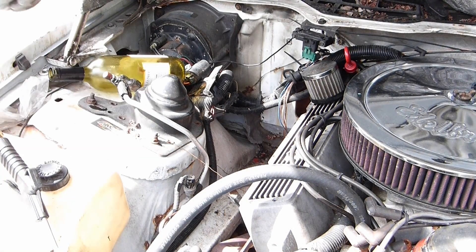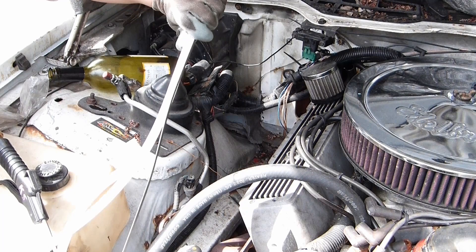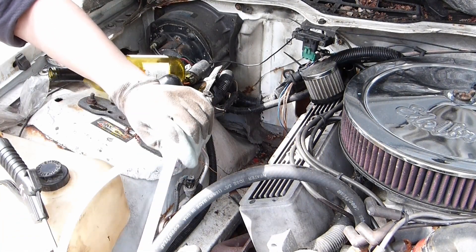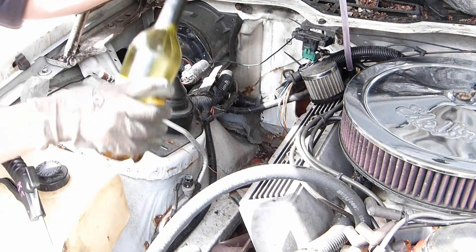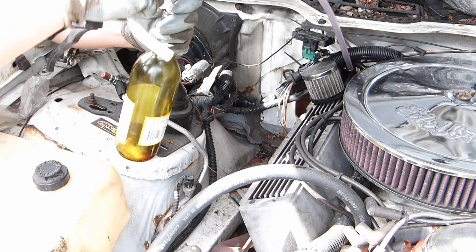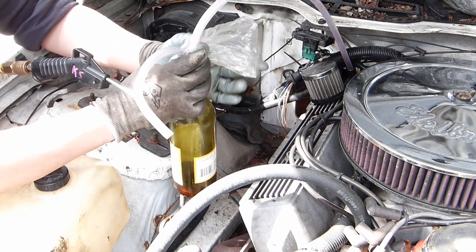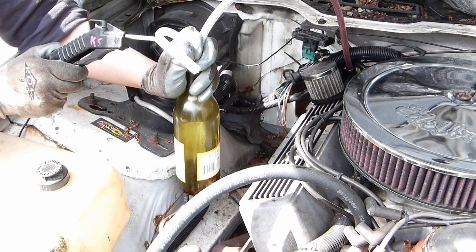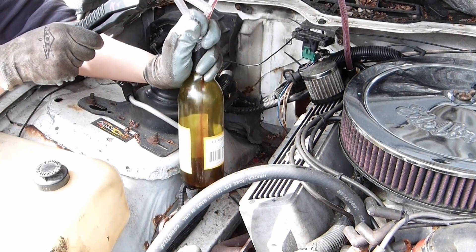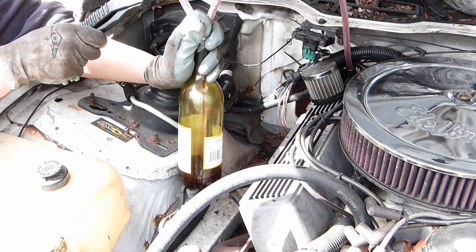We are in the engine bay. I pull the transmission dipstick and do a reference length to make sure I get to the bottom — though you might not be able to get all the fluid depending on how the hose interacts with the fluid in the oil pan. I stick the inlet hose down a few inches to where the bottle diameter gets larger, and the vacuum side I only stick in about an inch. I wrap the gasket around one time, clench it with my fingers over the middle, which creates a much better seal than fingers alone. I start pressurizing it and it starts drawing fluid out of the case.